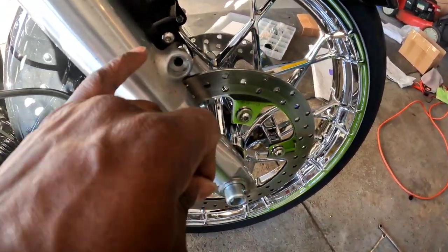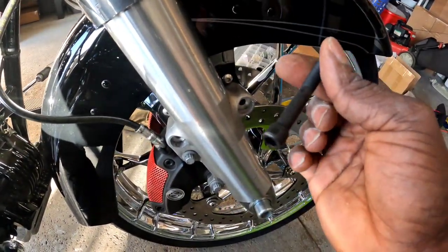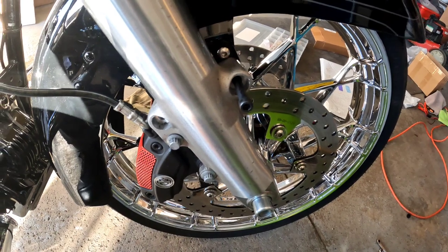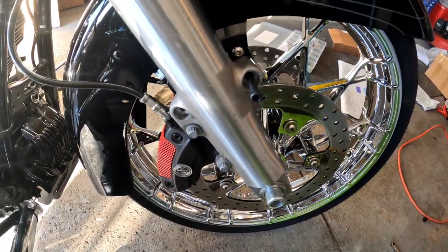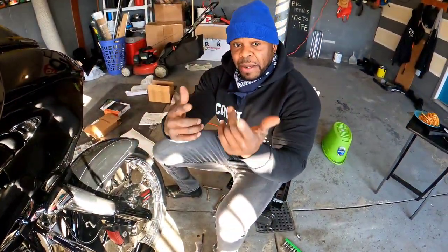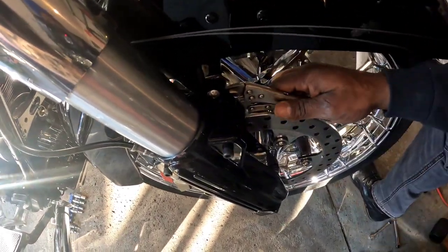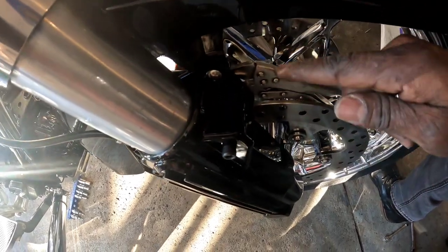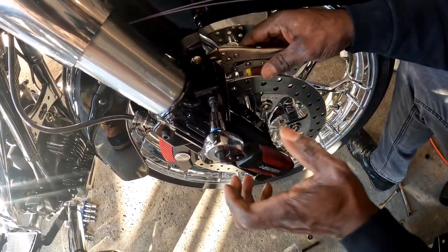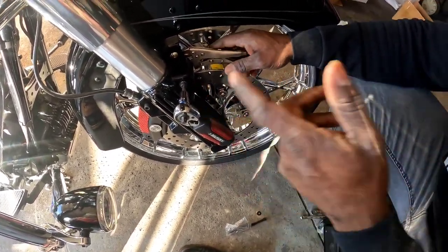I've got those bolts off right there — you can see that is right to the fender. I'm going to take these two bolts, stick that in, and on the other side put that washer in, then run those up with the bolt in the back — a relatively easy installation. The installation is going great. I am putting the fork cover on, just running the bolt back up through the fender using a small pair of vice grips to hold that back bolt. I've got that lock washer on, and I'm just going to take my ratchet and run that back up. Everything is all nice and snug — don't forget to put those lock washers on.